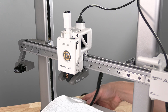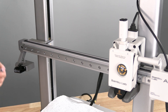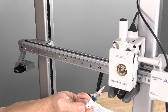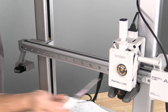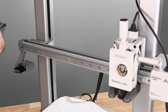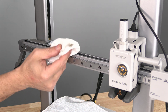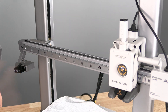Turn your printer off. Grab your tool head and move it aside. With your dropper or syringe, place oil into the little channel on this rail. Do the same to the channel under the rail. Doing it with the syringe is the easiest way you'll ever do this. Move the tool head back and forth. If the rail looks dirty, go ahead and clean that off also. Even if it doesn't look dirty, wipe it off. Be sure it has a good oiling in that slot, and you're all set.